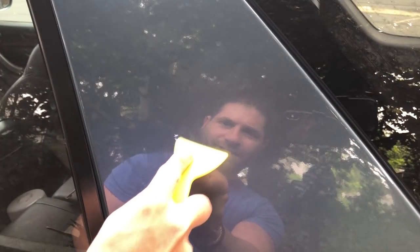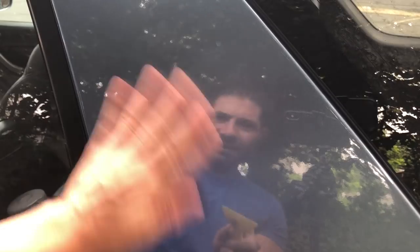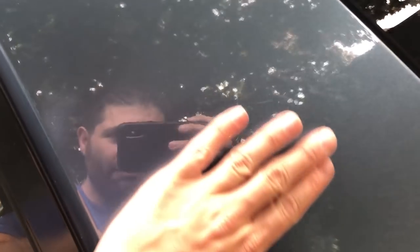Any little bit of residue left you can just very gently scrape it. So that's what it looks like right after one pull — I cleaned it all up and it has definitely lessened the impact. It did pull it out a little bit, as you can see, but that's the whole point — you pull it out and then push it back in. So right now I'm going to try to hammer down the little ridge around the crater and then give it one more pull right from the center.